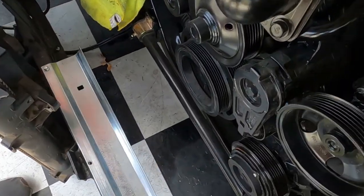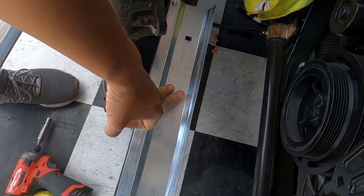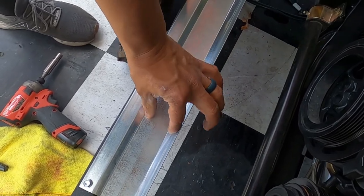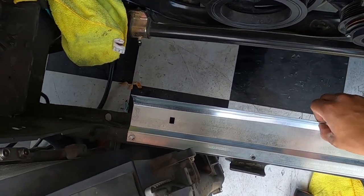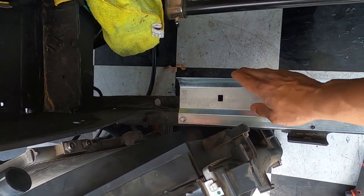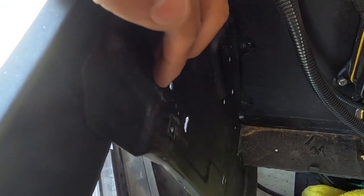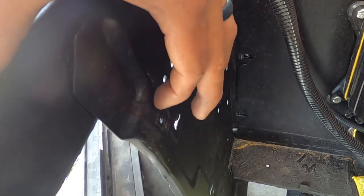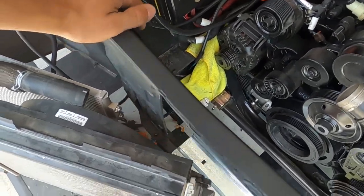Not to mention fabricate a few things. You guys can see I've already started — I kind of made this little radiator support holder, this bracket right here. Basically the radiator will ride right there and sit there. I raised this lip up a little bit — it's just galvanized steel, very thin — just to keep it from sliding off. I got it mocked in there and realized we're hitting right in this area, so I'm going to have to notch a section of this out right here, cut it up so it sits nice and flush.